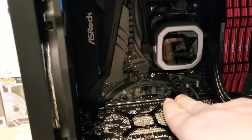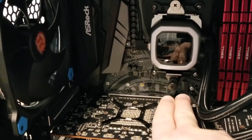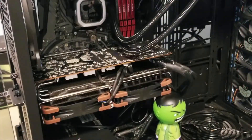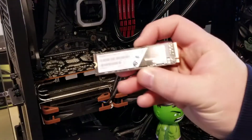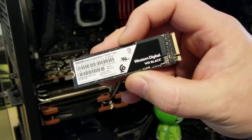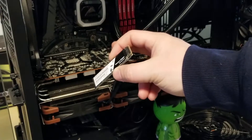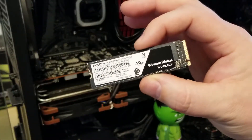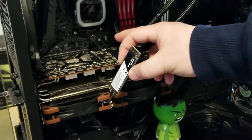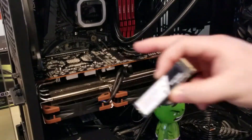This is where the drive will plug in — that's your M.2 socket. You should probably have your computer laying on its side to do this. This is your physical drive. You'll notice at the end where the gold color is, there's a little notch that makes sure you can only put the drive in one way. If you look at the motherboard close where the drive plugs in, you'll see the notch is on the bottom part of the socket. At the very back there's a notch where your screw goes in as well.